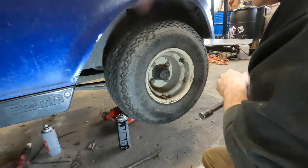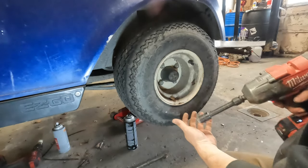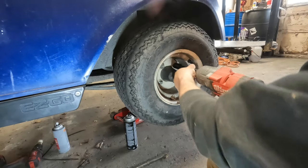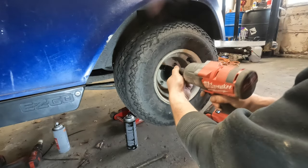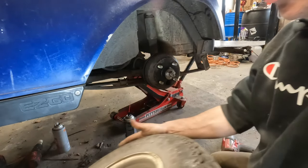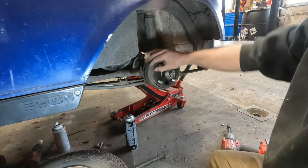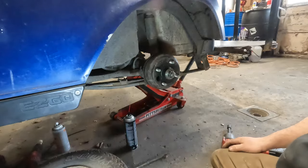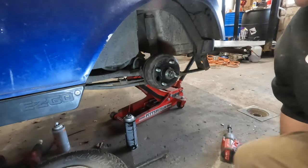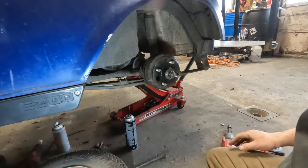So when adjusting the brakes, don't take the drum off. Just leave the drum on. These aren't even tight. Leave the drum on. I mean, unless you have to take the drum off because the splines are shot. See how loose that is? And the cart is in neutral. Now here's what I do. Unless you're doing a brake job, like where you're taking the drums off to replace the pads, you don't have to get all crazy and nuts with it.